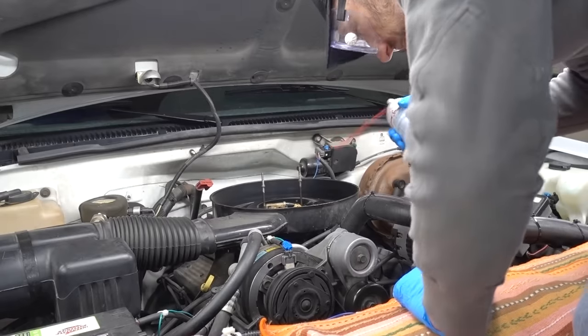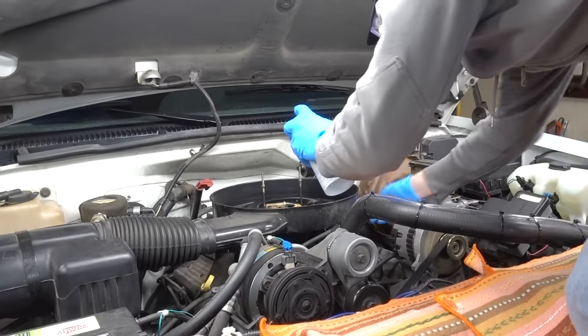And that hot soak, the motor actually needs to be hot. So that's what I'm doing here, just to make sure that I do get smoke out of that tailpipe after the hot soak. Okay guys, the fans have cycled on and off a few times. Now I know the motor is hot enough for me to begin the Seafoam application. All right guys, here I go.